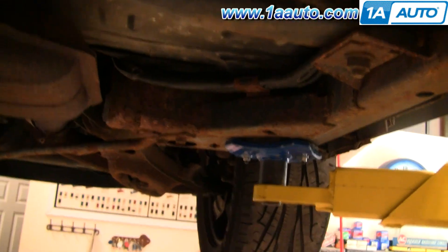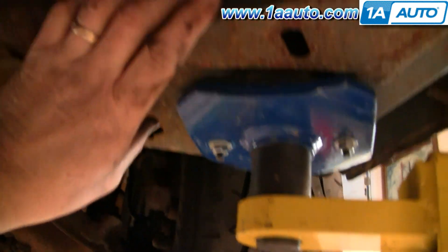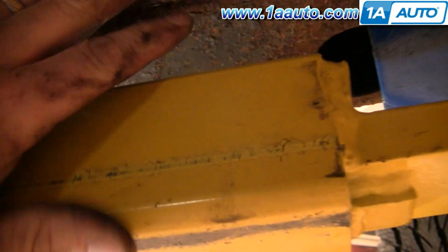If you're just looking to lift one wheel off the ground, you'd want to lift in this area of the frame in the front. This is the front passenger side, rear passenger side — this area of the frame here where it kind of bows in before the wheels. The same thing on the other sides.